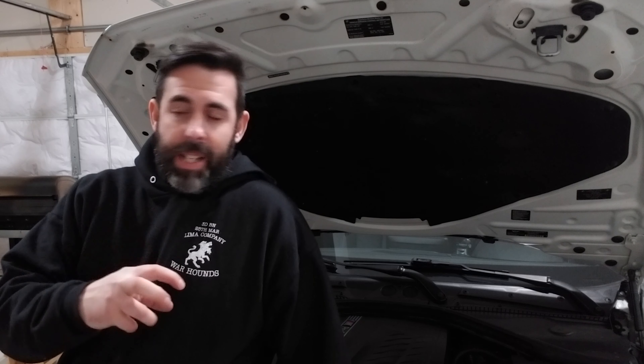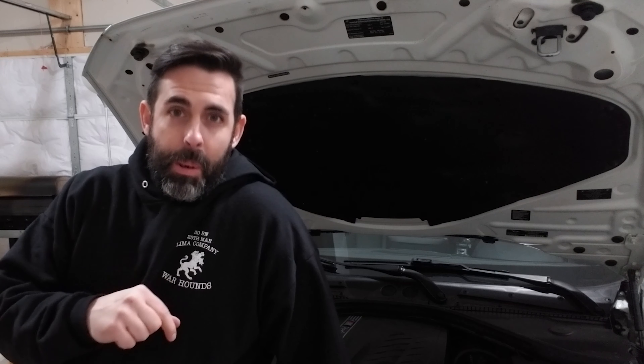If you're interested in purchasing this billet aluminum oil filter housing cap from ECS Tuning, check out the link in the description below. That's it — pretty straightforward. Old cap out, remove the birdcage, birdcage into the new cap, replace the seal, oil filter in, done. Shouldn't take you more than 10 minutes. I really hope you weren't unlucky like I was and you're able to get the birdcage out of the old cap and into the ECS Tuning cap without any issues.